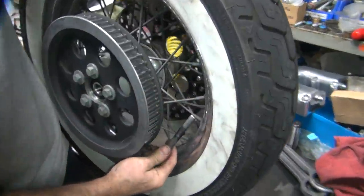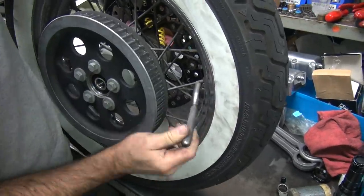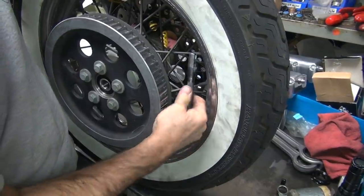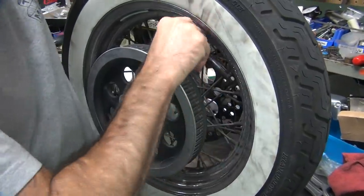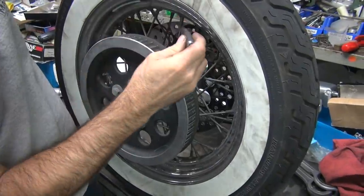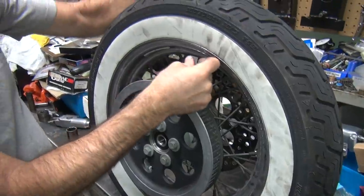Maybe I should tighten instead of loosen. It helps. Now if you do everything equally, the rim will stay relatively in the same spot. I was going to ask that. Then I figured it out when you said one turn each side. One flat actually, but one turn of four flats.